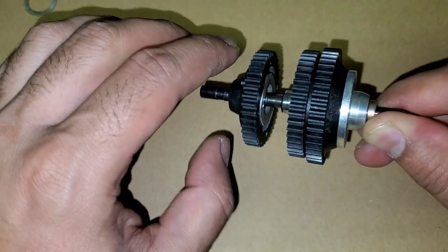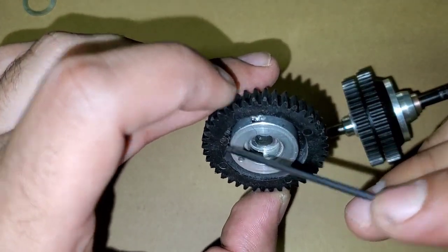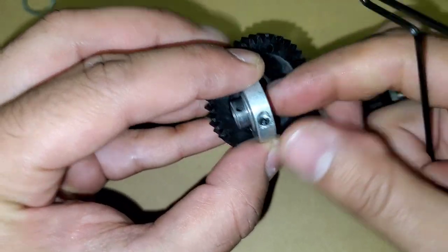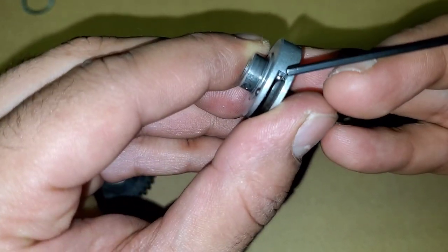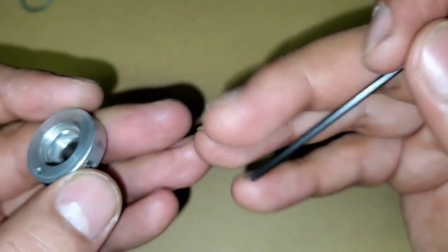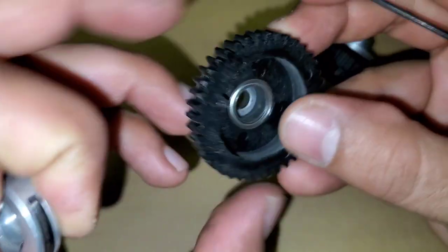Number one repair: we've got to get that pin in there. Number two: the third speed cam nub is stripped. As for the grub screw — that's the one you need to adjust. It has a spring in there, and there's a tiny little ball bearing. That spring is compressed by the grub screw, pressing against this cam which opens up based on RPM — it's centrifugal-based. This part comes out and hooks, then catches on the nub inside the gear.